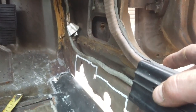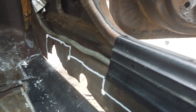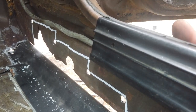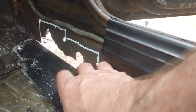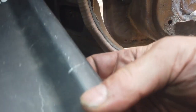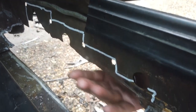I've inspected where the rot is on the floor - not that much but enough that needs doing. Cut out the rotten metal, then shaped one of these repair pieces just like this - it's a good fit. You can buy a long full piece of the car but I've just cut the piece that I need. The rotten metal's gone, and we needed a floor edge that was decent - so it's handy to have this little floor repair pad.